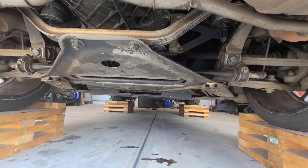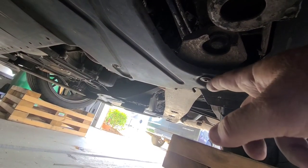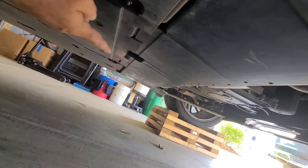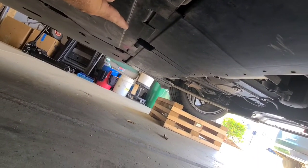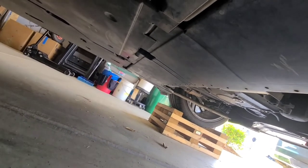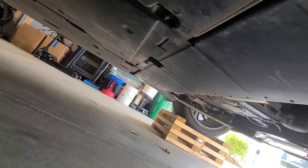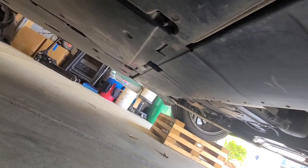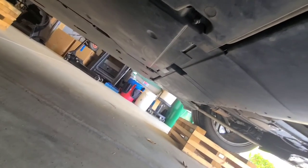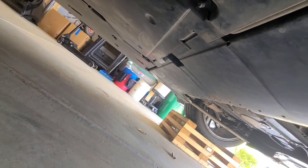I'm going to take off all this under-tray stuff and then probably call it a day. There are more T25s holding this very front under-tray piece, and in the middle there's a hole with a 10 millimeter nut with a large square washer on it to keep the under-tray up against the stud. There's overlapping and underlapping of one tray in the other, so you want to get those lined up properly. I can see I've got it wrong on the far side and correct on this side.